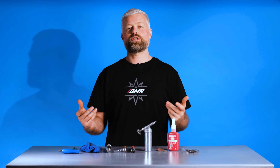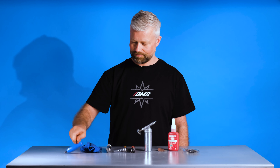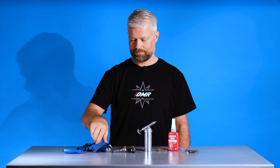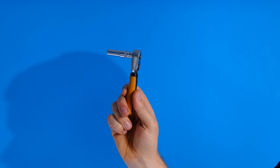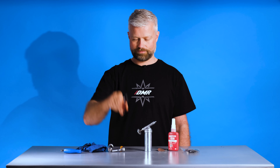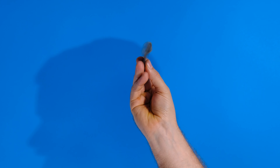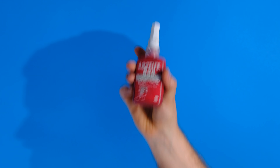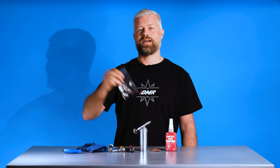Whether you've got a V12 or a Versa, the tools you're going to need are the same — it's just the service kit that changes, because there are different seal arrangements in the V12 compared to the Versa. The tools you'll need are a 6mm Allen key, a rag for cleaning, your V12 service tool, a 9mm thin-walled socket with a driver, a torque wrench, some grease, some abrasive paper, some bearing fit such as Loctite 638, and the correct service kit.